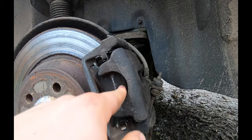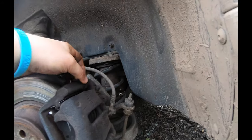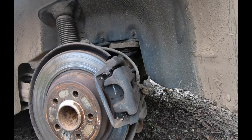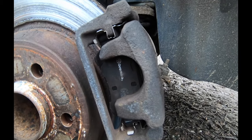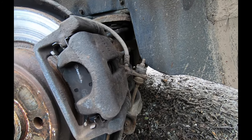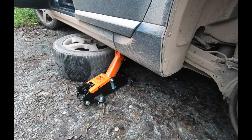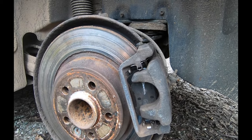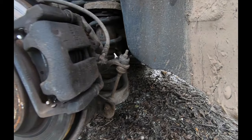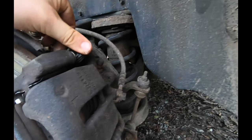There's definitely some sort of binding going on - whether it's the caliper not releasing properly or whatever. You can see this horrible corrosion here, it's brutal. We've got to get that sorted. To be honest I think it's time to have the wheels refurbished, but we haven't all got loads of money to spend at the moment. So what I'm going to do is check the quality of the pins - they don't look that well greased.